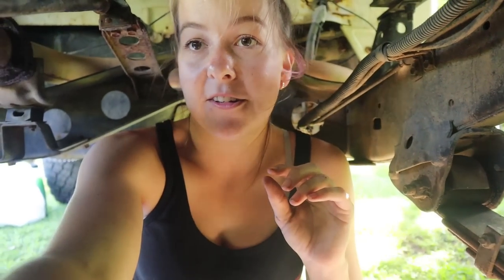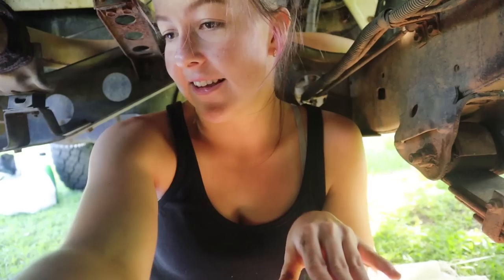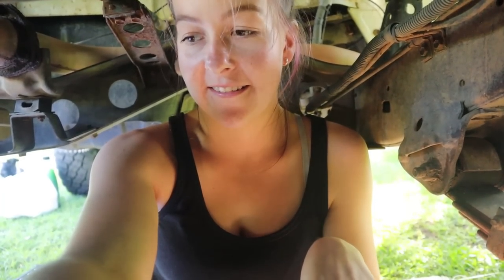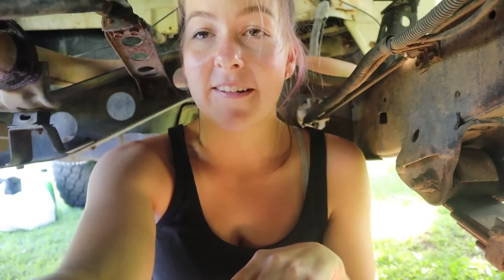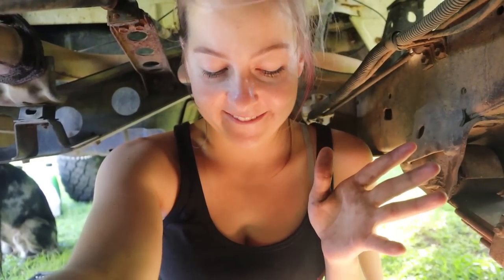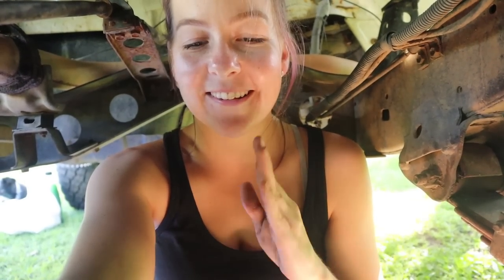So you need a really, really small torque wrench that would have 0.7 to 1. Spin it. If it's below 0.7, it says to go up in increments of 13 newton meters. So you'd hold the flange, tighten the nut 13 newton meters, measure it again, and then don't go above 1. Because if you go above 1, you've crushed the spacer too far, is my understanding of that, and then you've got to replace it again. But we're not going to do that. We've just gone to what it was, plus a little bit more.